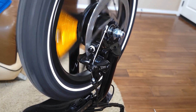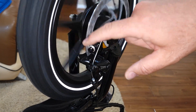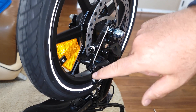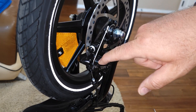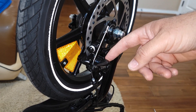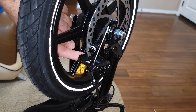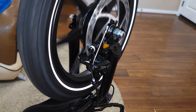It's very easy to set up. To recap: first, tighten these two bolts; then from the other side, tighten the nut very tight so the wheel won't move. Not every brake will need cable adjustment — it depends on the system. On this bike, the cable was a bit tense, so I loosened it about two millimeters. Then tighten the two nuts back, unscrew this bolt a little bit, and the brake should sit like this — not touching.